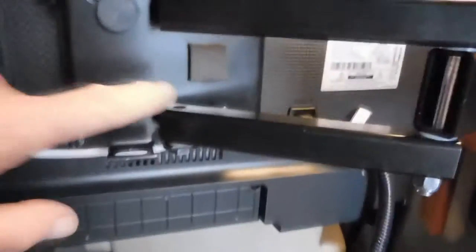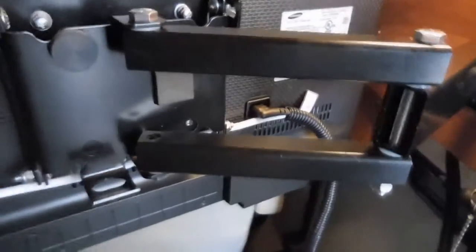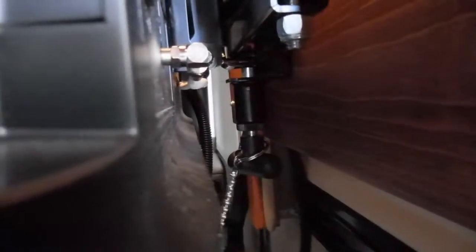I also applied a rubber pad here — this is a stock one — and an extra pad I put in as well. What that does is provide a little more secure mounting so that it's not going to rattle back and forth while driving. With those rubber pads added, it enables this locking mechanism to have a more solid placement, so there's not going to be any rattling.